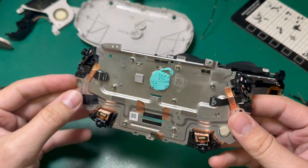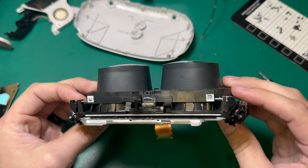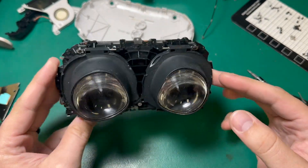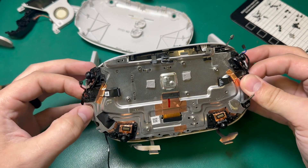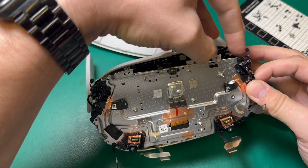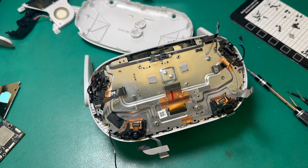Now this aluminum chassis is free and it can go on our new LCD. We're going to align that and screw all this back in. Now that all screws are back in place, I can go ahead and reinstall the assembly. We just need to make sure that all these cables are out of the way before we force everything in — it would be a travesty to come this far and then damage a cable.